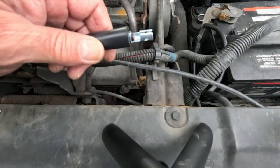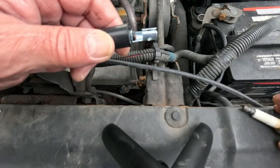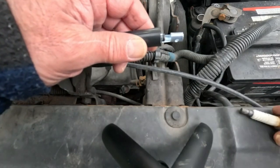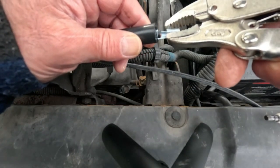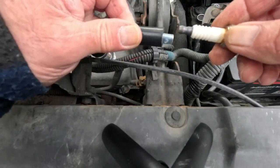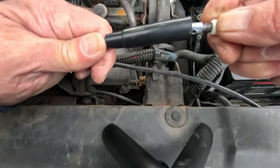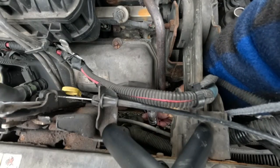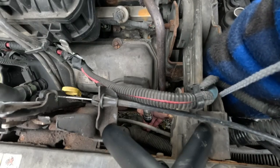I don't like the way this is popping onto the spark plug — it has two loops. Here's an old spark plug I removed, so what I'm going to do is tighten that up a little bit with pliers. You want it to take a good bite on the spark plug. Open it back up, put it in place — after crimping with the pliers, that feels better, much more snug.